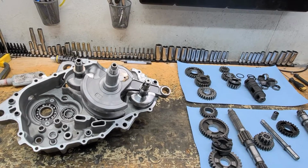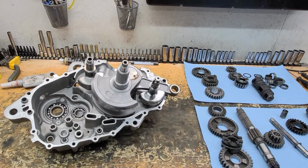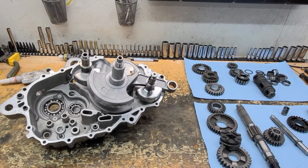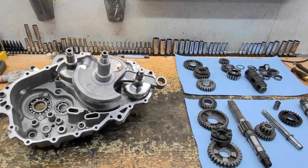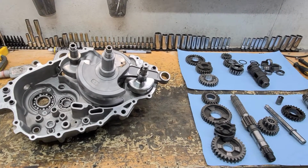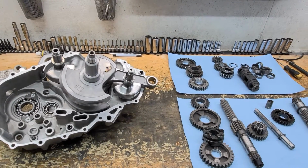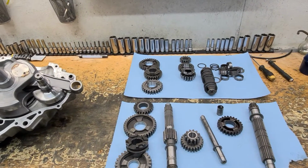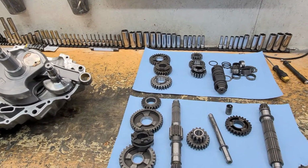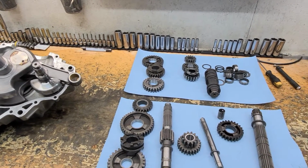So the previous engine had a piston and cylinder fail due to, I believe, detonation for the original engine. And then they put a crankshaft in it and put a piston and cylinder on a cheap rebuild at that other shop, and well, here it sits getting another rebuild. And so basically, it wiped out the crankshaft rod again. What happened was none of the engine stuff was disassembled and cleaned, so it had a lot of metal hiding in it, and that was evident by what we found.